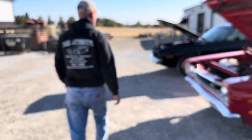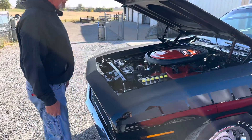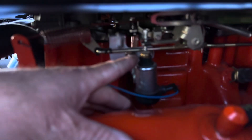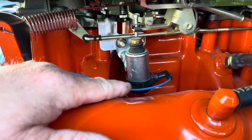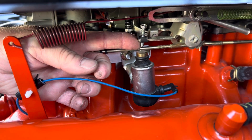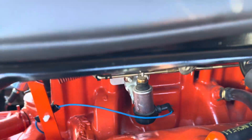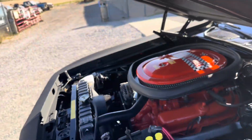Now let's go over and look at this six-pack car. This is all factory — an OEM restoration with an original idle stop solenoid. We have a 440 six-pack car here as well. This guy right here will once again raise the idle while running, but when you shut the car off it allows it to die. That's factory on a 340 six-pack car.